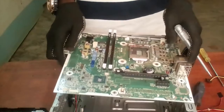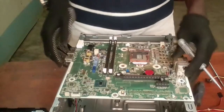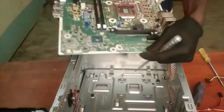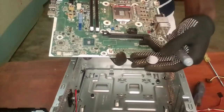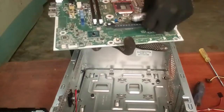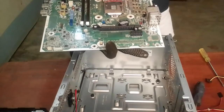During the reassembly of the system unit, carefully follow the order and everything will go smoothly. Start with the motherboard and proceed with the other elements. We remove the CMOS — this is the CMOS battery. When the CMOS battery is faulty, you can reset it or replace it. Here you also have the expansion slots, where you can put expansion cards such as the network interface card or video graphic adapters.